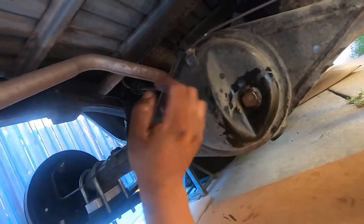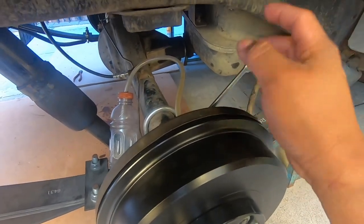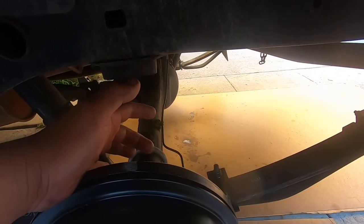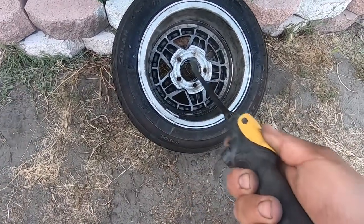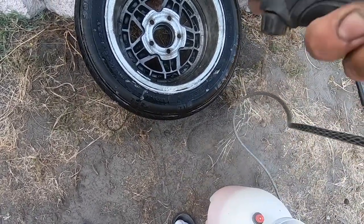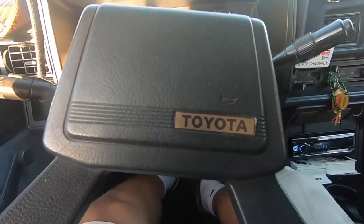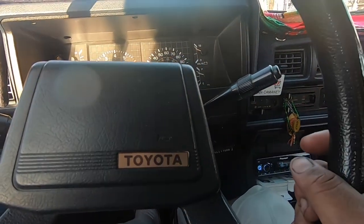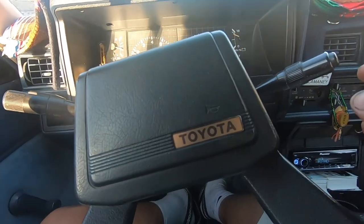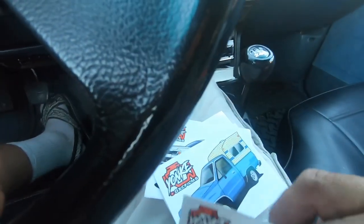Now let's bleed the brakes. I have someone in the cab and we're going to start pumping the pedal to bleed the passenger side rear brake. Now that we're done with the passenger side, we're moving over to the driver rear side — same thing, pump it and then open it up until the air comes out. Before we put the rim back on, we're going to spray with some degreaser because there was a lot of diff fluid on there from the leak. We're using Power Purple diluted with water and then we'll rinse it. We just pulled the truck out of the driveway and already noticed a huge difference — we don't have to apply too much pressure to the pedal to feel it stop. Soon we're going to be doing the front — rotors, calipers, brake lines and all that. Make sure to stay tuned. Follow us on Instagram at yonke_underscore_oxcfilms. We'll see you on the next one.